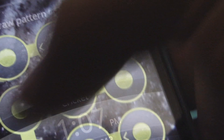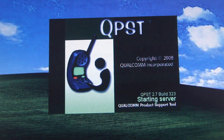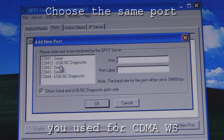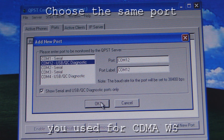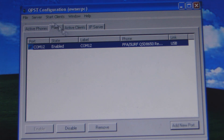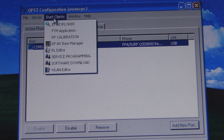My phone has rebooted and we're ready to do the rest of the flash. You want to connect the phone back to the computer. Now we want to open up QPST Configuration. You'll have to go to add a new port and choose a USB QC Diagnostic port. I have two different ones because I have a dock on my laptop, but my phone is port 12. So I'll hit OK. Over here where it says phone, you want to see it say 'surf.' If it says 'no phone,' then you're not on the right port. Mine says surf.